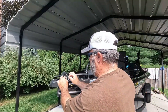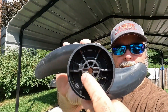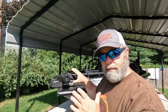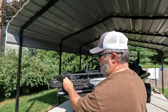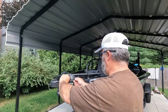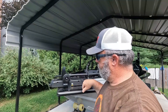I've got a brand new pin. I'm going to stick the pin in — it's got to be equidistant on both sides in order to fit and marry into the prop. So you just kind of line it up by eye. As long as it pushes on and seats properly on the housing, you know that pin is in that slot. Put the washer back on, put the nut back on, cinch it down a little bit. Don't have to go crazy, but certainly don't want it coming off. And you're done.